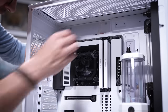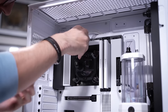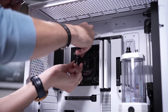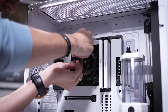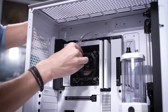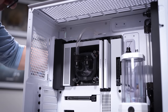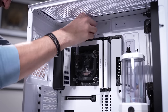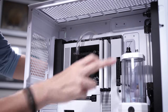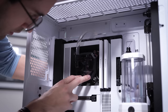These next two runs will require quite a bit more tubing length. I'll keep it all as one reel so I don't short myself. Push this onto the barb on one side, make sure it's all the way down, compression fitting nice and tight. There's actually enough slack here that we can safely angle this down behind the motherboard tray without the tubing pinching at all - that's really nice.